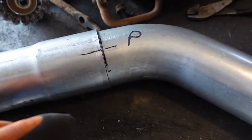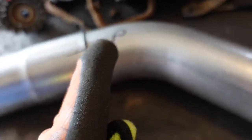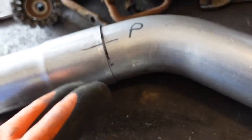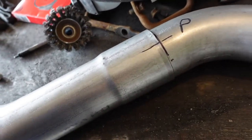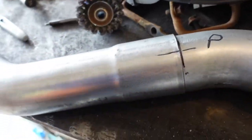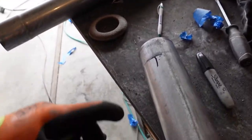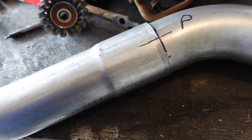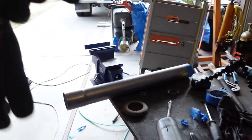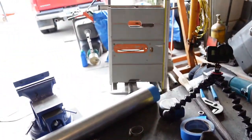It's coming together quite nicely. Not sure if you can see what I was doing underneath there, so I want to show you on the bench here real quick. I got it kind of positioned under the truck the way I wanted it, and then I just made some reference marks for how far the tube was going into the other exhaust tubing and how it was oriented. That way when I put it back under there it should line up the way I want it. So I'm going to tack it in a few spots and then take the welder over to the truck and tack it to the mufflers. I'll end up busting those tacks loose so I can weld it all solid. Then get this part tacked, because when I was trying to hang the rest of the exhaust pipe going out the back it kept moving on me. So get this all tacked and then we'll route it behind the axle.